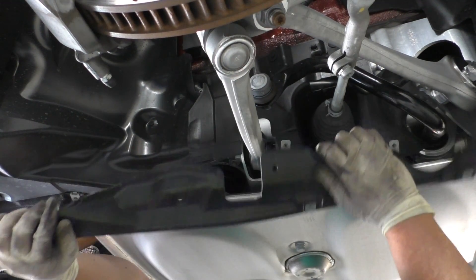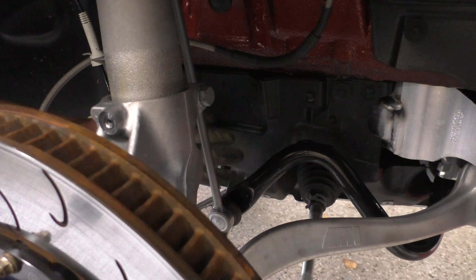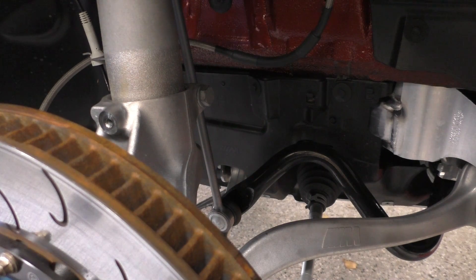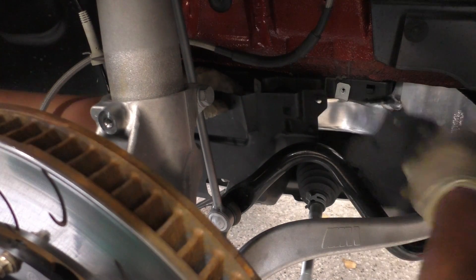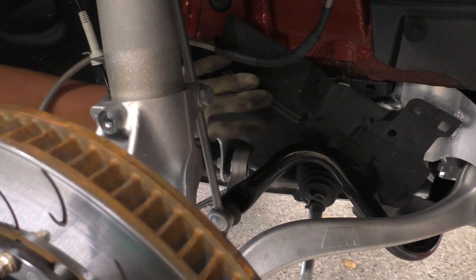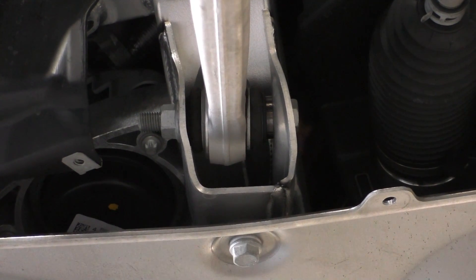I've removed all the screws so you can see that this lower cover just simply pulls right out. Next we have to remove a couple more 8mm screws to remove or at least maneuver this upper cover out of the way, because it's actually blocking the bolt on this forward side. Once those screws are out, these just kind of pull apart — they've got some little clips and pegs. You don't actually have to take it all the way out; just rotate this rear piece towards the front of the car to get enough clearance where that bolt hole is. Now we can see that the wishbone-to-subframe bolt connection is free and clear on both sides.